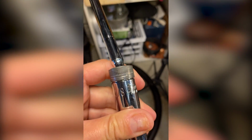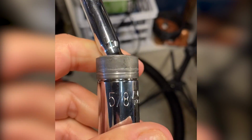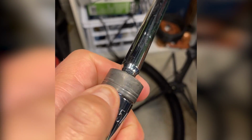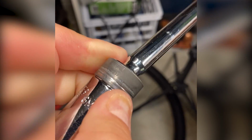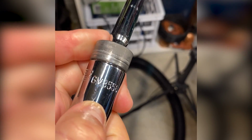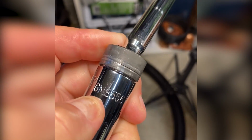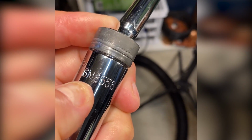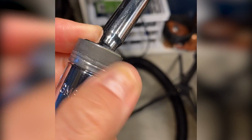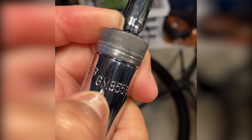And you can see here where, as I was turning this wrench inside that bore, it was stripping off the sides. That was my first clue, you could see this damage here. And then that's when I really panicked, because I was afraid that I'd also done some stripping inside the bores. One of the bores did end up with just the slightest bit of ringing like this from the turning, but it was very minimal, and the bores are very long.